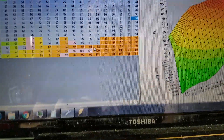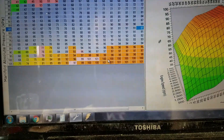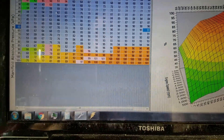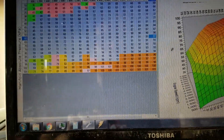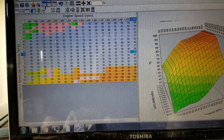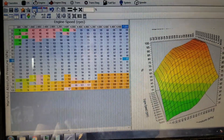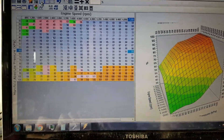As you can see here, I was band-aiding before on the stock injectors, going over 101 to 100 because they were maxed out at 95% duty cycle, which is not good. I don't suggest it — you are definitely going to have to put new injectors on with this new Dorman manifold. The stock ones definitely will not be able to keep up, especially if you're running a larger camshaft like a Torker V2 like I am.